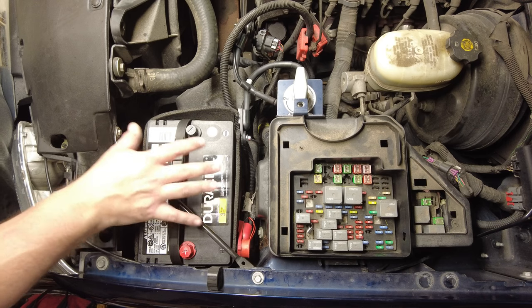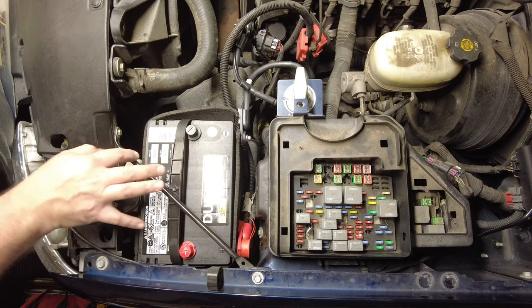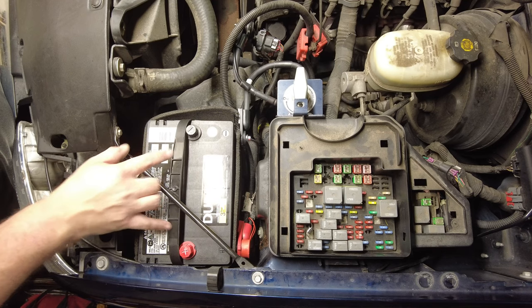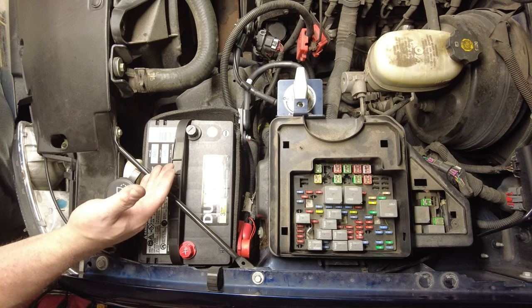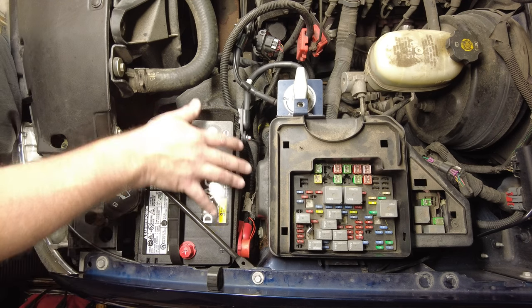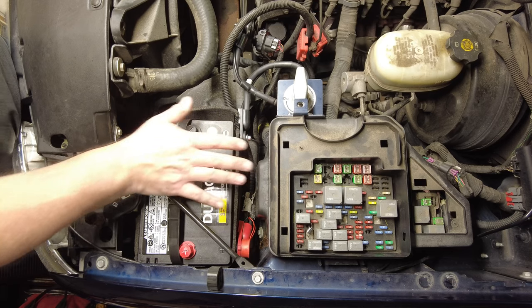This battery as a 78 comes only with side posts. This battery in a 34 only comes with top posts. So you can either get the 78 dual post or the 34 dual post. It's the same battery. So I retained the factory side posts on the battery.